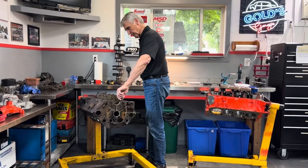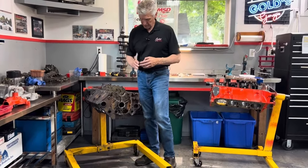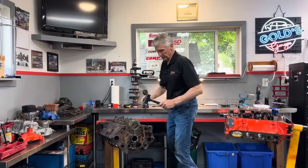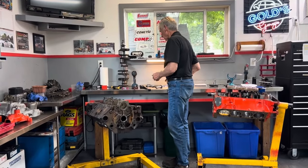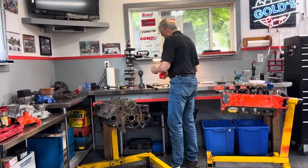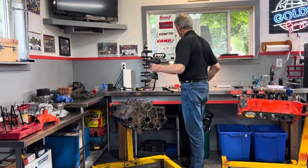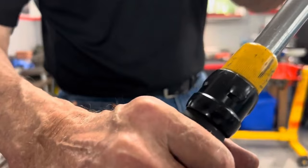We're going to use the lube in this test. I'm installing the main bearing cap — making sure it's facing the right direction. I'm going to tighten it with the stock bolts and regular engine oil. When torquing, another point to make: static friction is more than moving friction, so you don't want to tighten in little baby increments. You want to make a good swing at it, because if you stop and start again it'll take more friction to get going. Get it snug down, then go to full torque on the next pull.